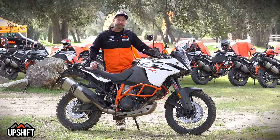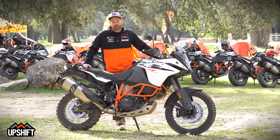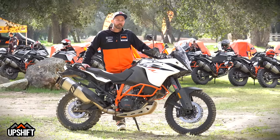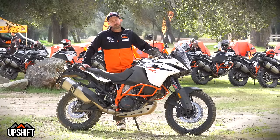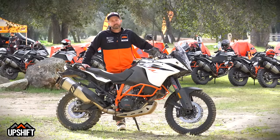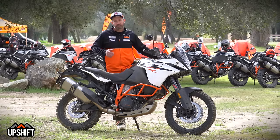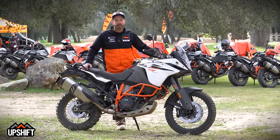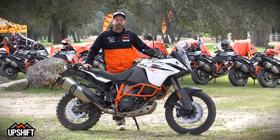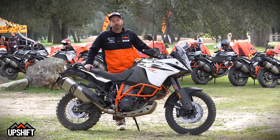PDS is something that's been used in KTM's EXC line for many years, and this is the first time we've actually put it on a big adventure street bike. PDS — progressive dampening system — basically makes the suspension more progressive. As you get closer to the bottom of the stroke, the suspension firms up, gives it more bottoming resistance, and prevents that hard bottoming you sometimes feel on these big, heavy bikes.